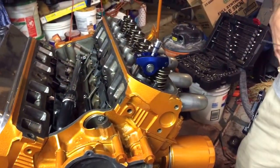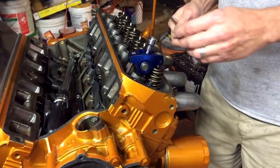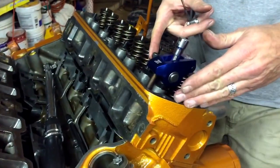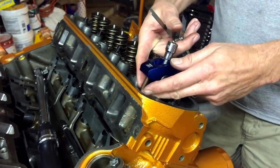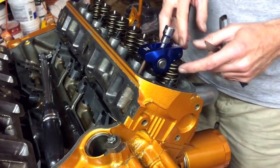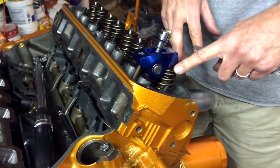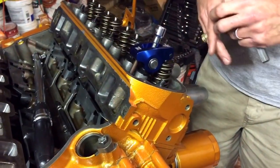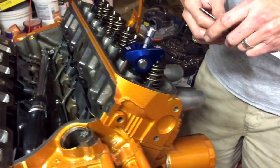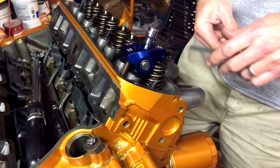There are a lot of ways to size push rods — here's how I'd suggest doing it. I started with a stock push rod. If you're going to upscale one of these 5.0-liter motors, get rid of the stock push rods regardless. They were designed for fairly weak springs. If you increase spring compression force with a strong double or single spring, you risk bending these stock push rods, so throw them away no matter what.